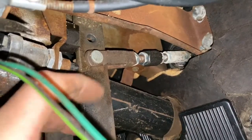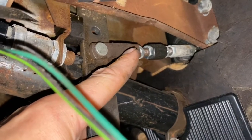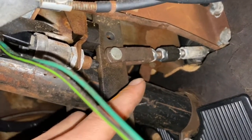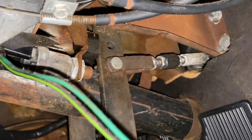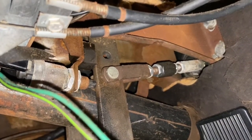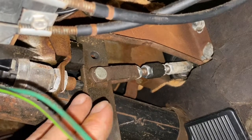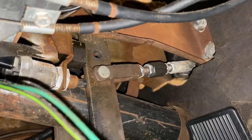While we're at the dashboard, you want to make sure that the push rod going from your pedal to your master cylinder is adjusted right. You want a little bit of free play in it before it actually pushes on the master cylinder, and you may need to get some adapters or a whole new shaft to make it all work. With a little patience you should be able to get a little bit of free play before it pushes the master, and then you'll get it set up right.